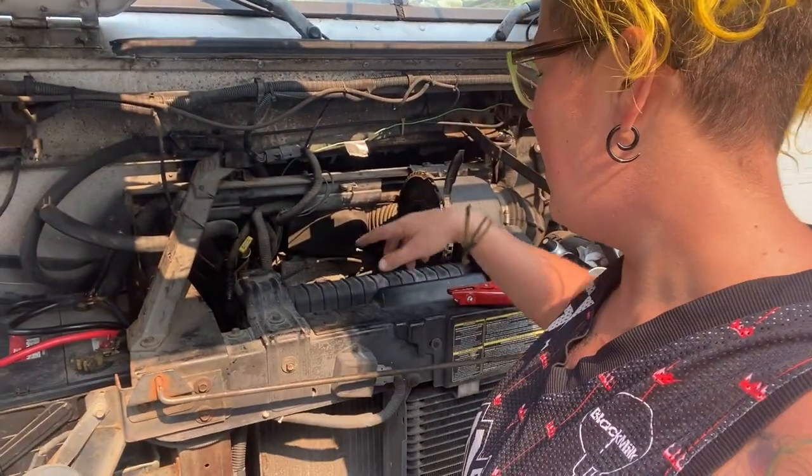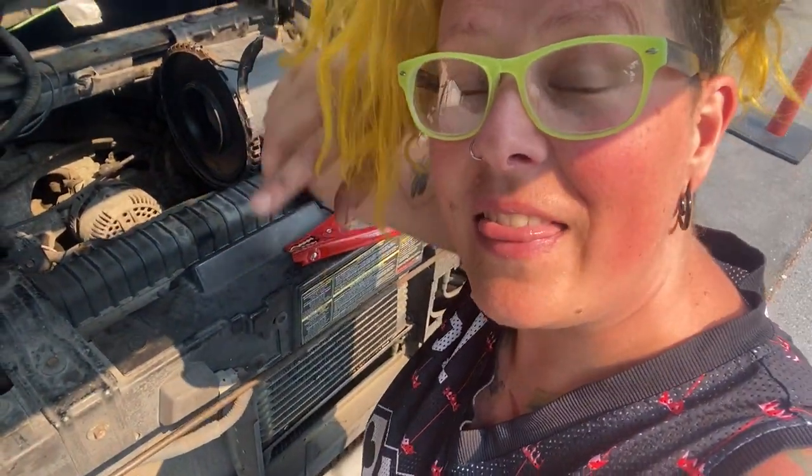Yeah, it's good. It helps protect the alternator from overheating. It keeps the starter battery charged. And we will install this, if you can see the whole shiny silver wire, that's a temperature sensor, so we can check that the alternator is not overheating. Learning new things every day. There are lots of different ways to wire in a DC to DC charger, and this is the way we're doing it.